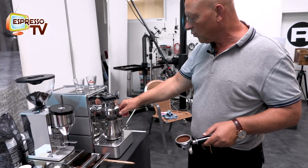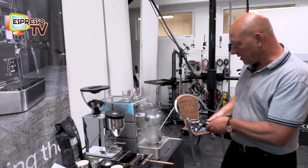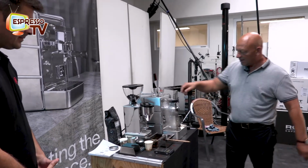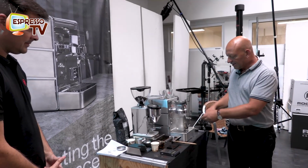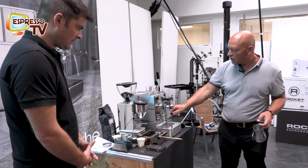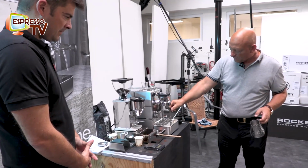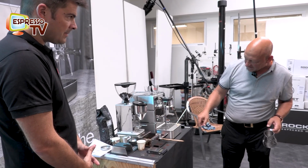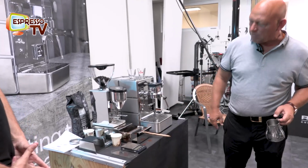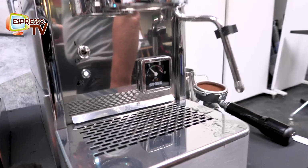And then it's more or less the first idea, but now I just want to check, because the machine is new, so when the machine is new, better to let all the first water run. And so this means heat exchanger, okay? So you can work in parallel. Like here, the steam, of course, we wait now a little bit until the pressure of the boiler comes back. It's about how many bar? What do you think? 1 bar? Yes. Okay. 0.9, 1 bar.